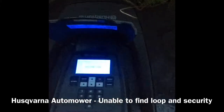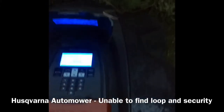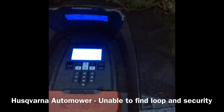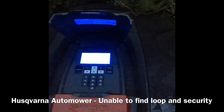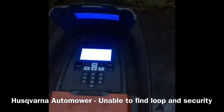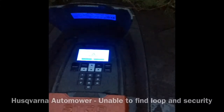If I pop the panel, it's telling me to press start to mow and it's now saying please wait. It's going to pull up a problem and it will tell me that it cannot find the loop — the wire running around the edge of the garden. To solve this I need to either reset our jumper or go and check the plug. It says no loop signal.